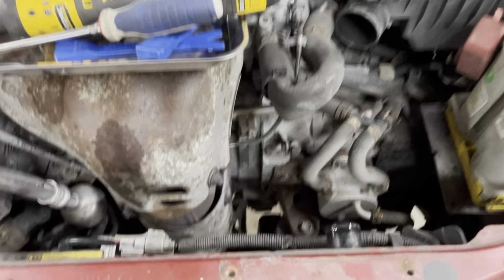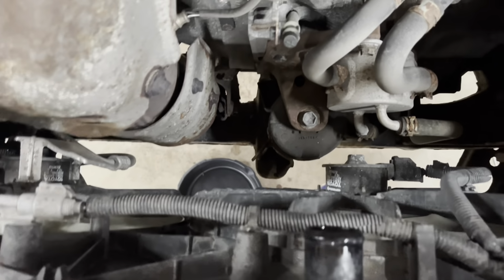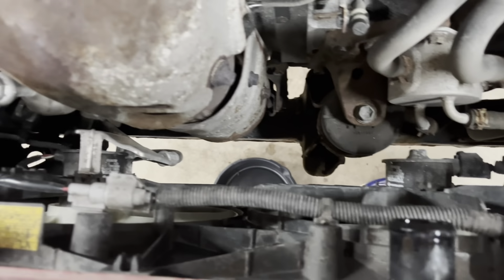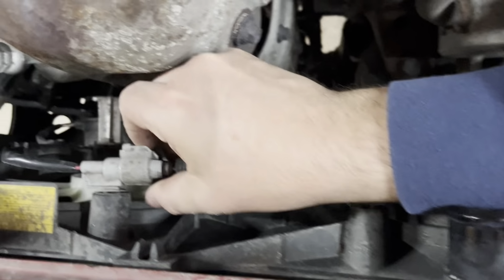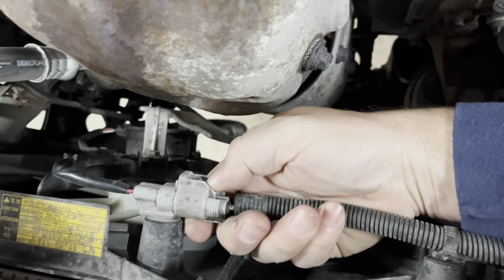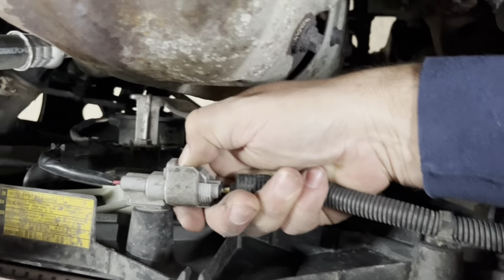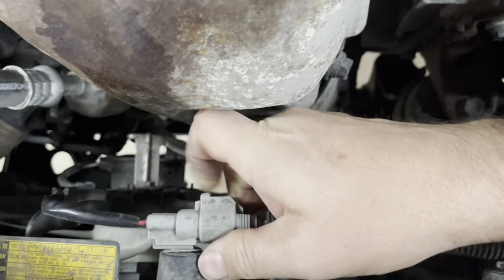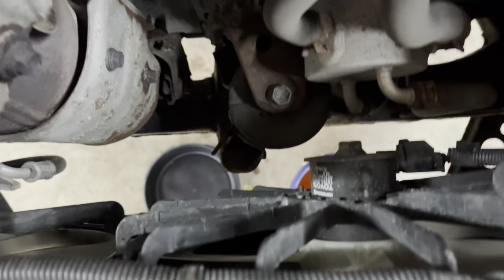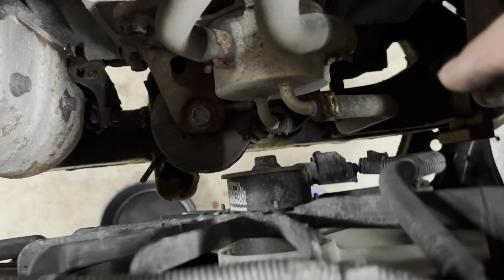The next step to getting this radiator out, we're actually going to take the fan out. So first thing we're going to do is start disconnecting the fan wires. I think if you just push down on these, they should come right out. I'm going to wiggle them occasionally. So there's one here, and there is another here. So take those 2 out.